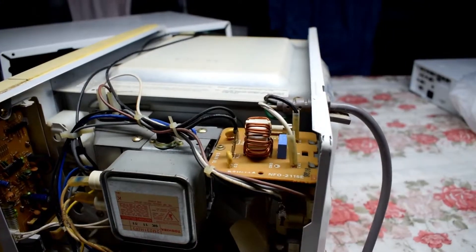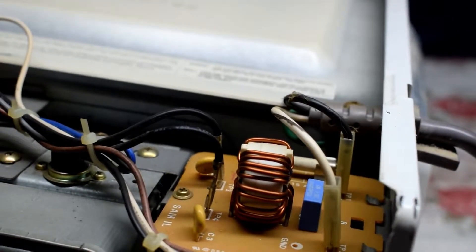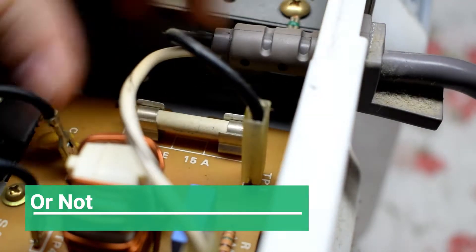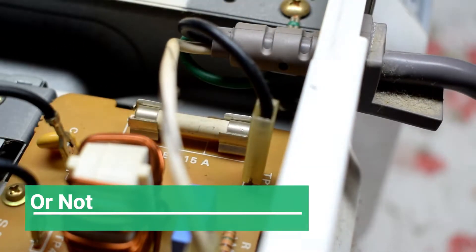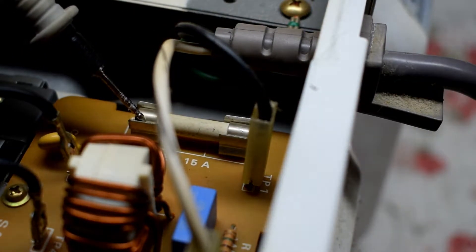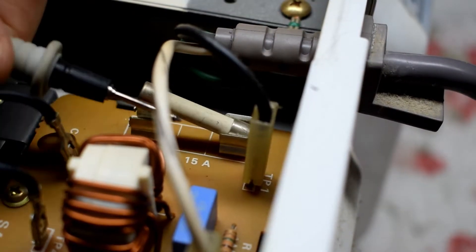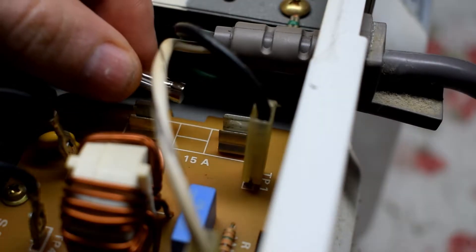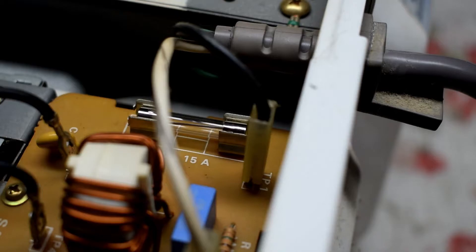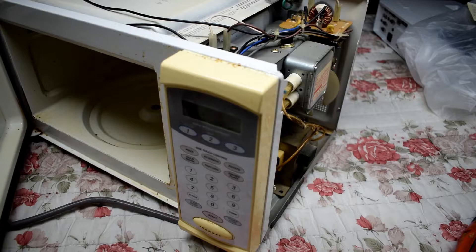The first thing to check out is this fuse. This one's probably a quick fix — it has a blown fuse. This is on continuity mode right here. Put a new fuse in here. You can see the oven turns on there.